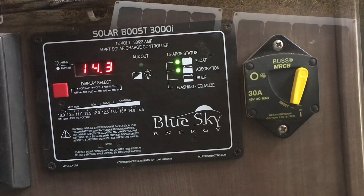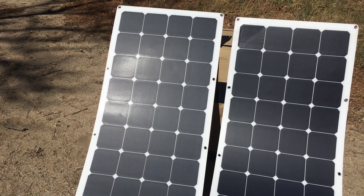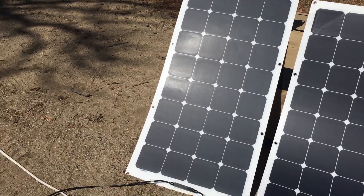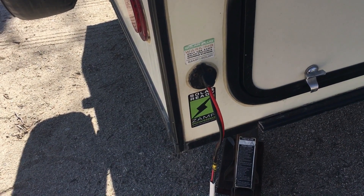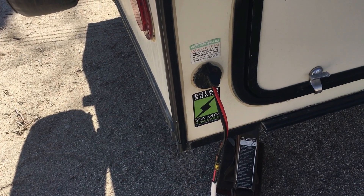We also have two portable panels for outside. These two panels are also wired in series — they're 100-watt panels with a 25-foot 10-gauge duplex wire. They plug into the Zamp controller in the back of the trailer. The Zamp wiring initially went straight to the batteries, but Jim rewired them to connect to the second 10-amp circuit breaker, which also goes to the charge controller. On a normal sunny day with a little shade we can see about 10 amps; with the portable panels we can see as high as 14 to 16 amps in perfect conditions with a low battery charge.